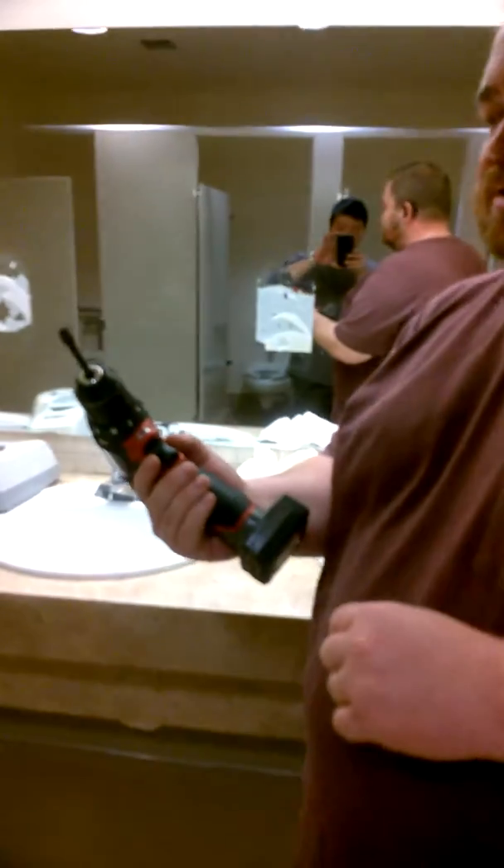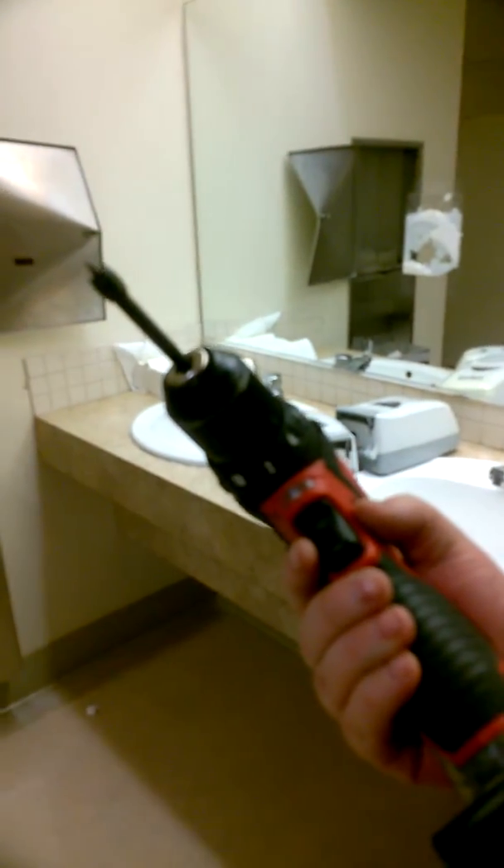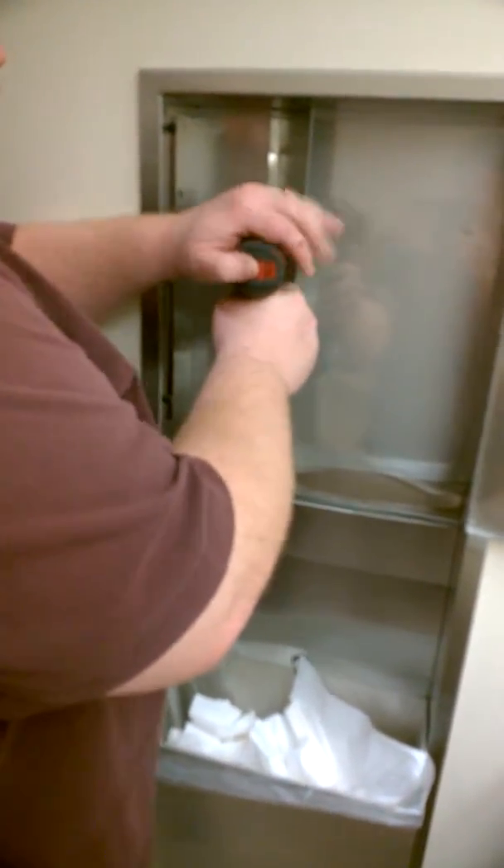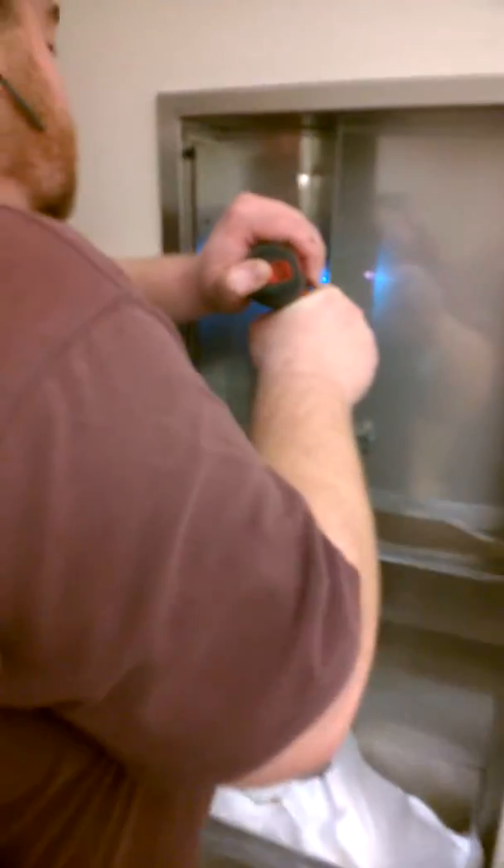Most of the time that will work, and for the occasional time that it doesn't work, we have this special drill bit that you can buy if you want. It costs about $30 and it drills really good holes in the spot welds. It can be a little tricky to use, but just to show you on one — you can see it punctures a hole in it. It actually pierces a hole in it and leaves the hole still attached. It's not focusing real good, but that's the backup tool. It's just the expensive backup tool.